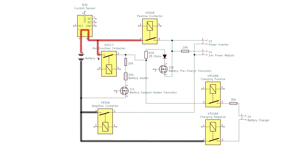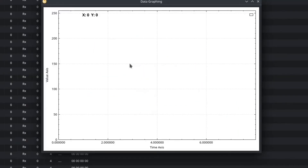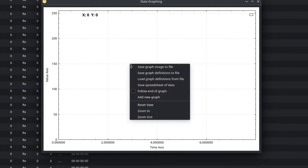Now all the high voltage circuits have been powered down and the vehicle will soon shut off the COM enable line as well, in order to save power on the 12-volt battery. We can now analyze captured data to show how the pre-charge operations of the Chevy Volt work when charging from the AC grid.